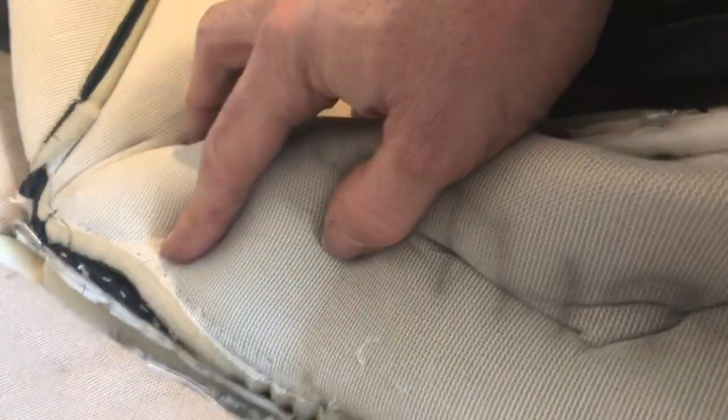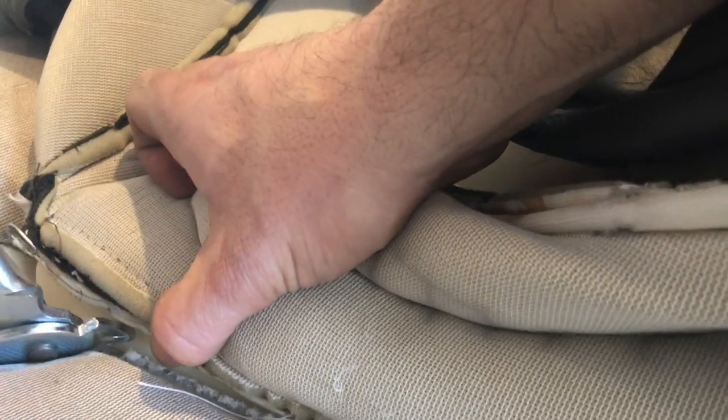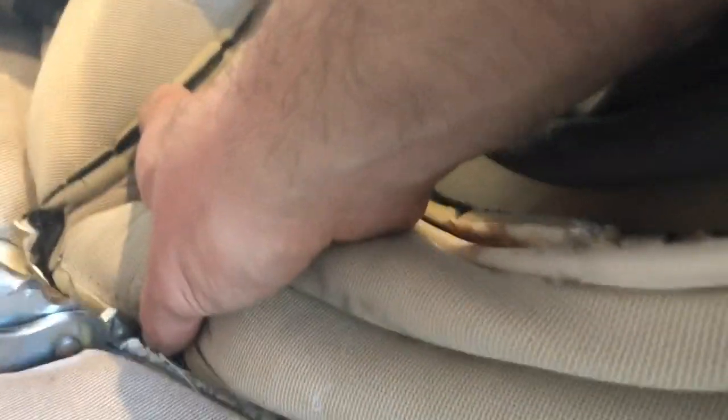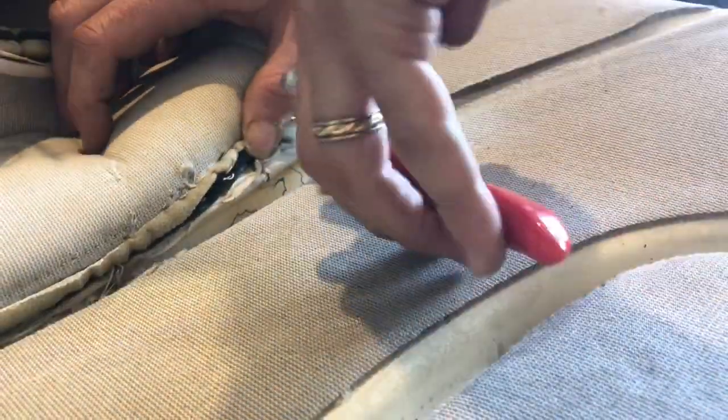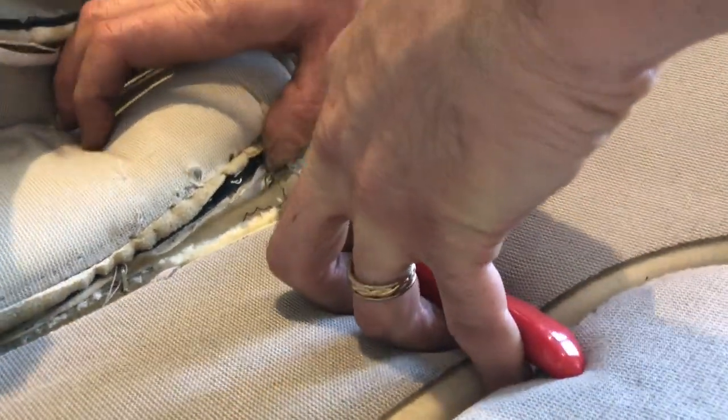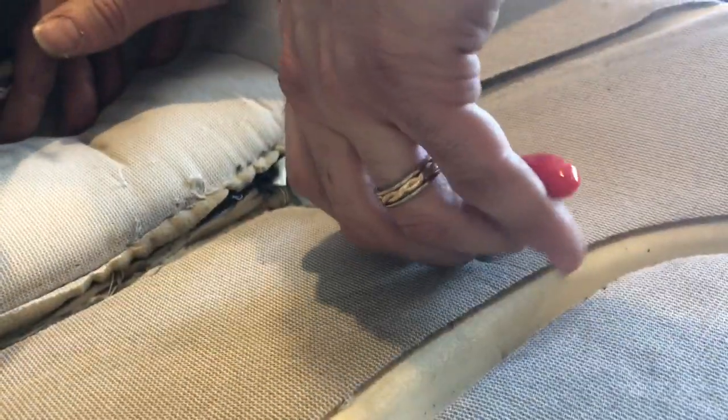One. Clip it into the seat first. Then push the bar down. Squeeze the two together. Done. Other side. Push it in the seat. What you're doing is hooking the hog ring in, so you hook it into the bottom first. Push the seat down. Hook it into the other rod and squeeze. And you're good. One, two, three. Sits nicely here.